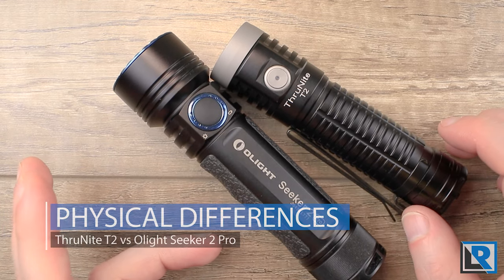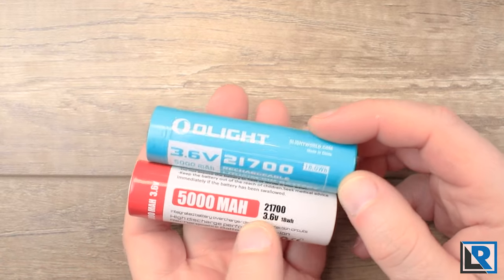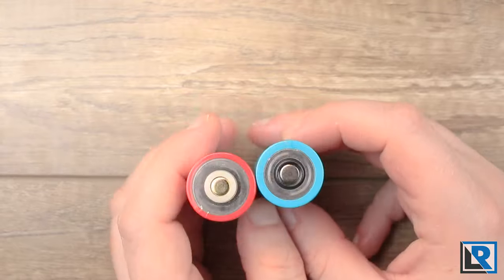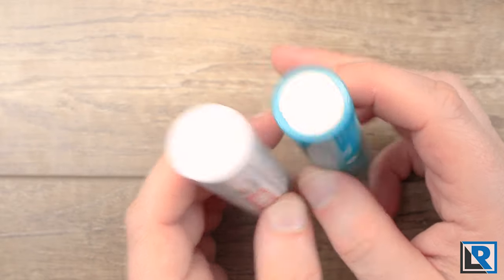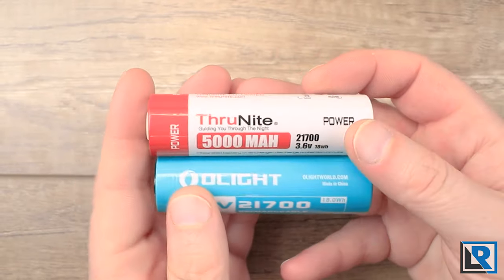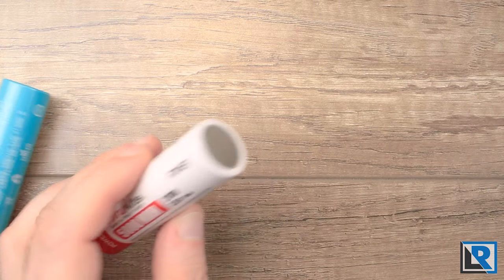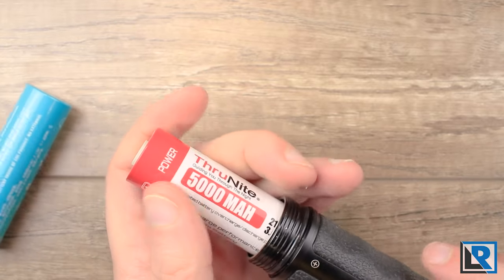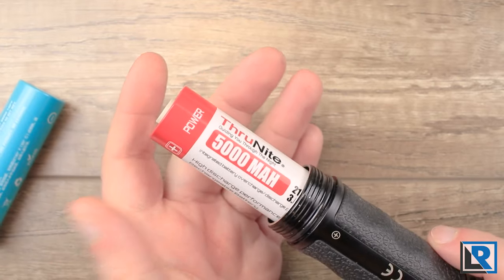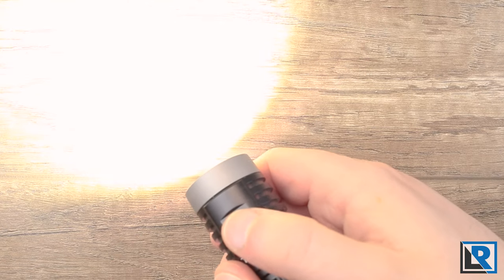Physically, I wanted to go over some of the differences between these lights, and then I'll talk about performance and night shots. Both lights use 21700-sized batteries with a proprietary contact layout — negative on the top half, positive in the center, and negatives on the bottom. These two cells are basically identical in length and ironically work in both lights. The Thrunite is a very tight fit in the Olight, but the Olight cell fits more easily in the T2 and lights up just fine.